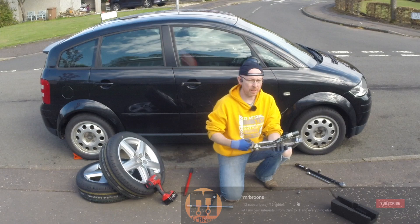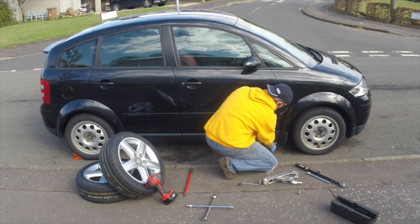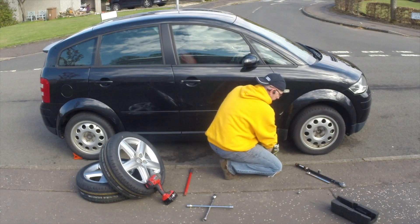The jack that comes with the car is very simple to use — just a screw-up adapter. Place it on the ground and place it inside the special hole. It's simply a case of pushing at the bottom and then pulling it out. Place it within the hole, straighten up the jack at the bottom so it's flat to the ground, wind it down till it's flat and then you can get some tension onto it. Then we can leave it like that.